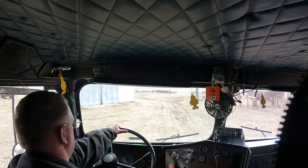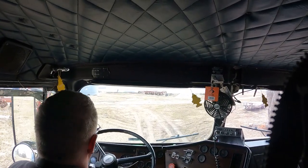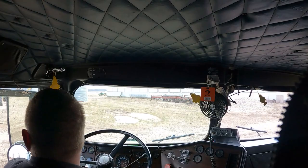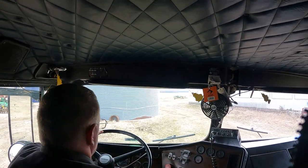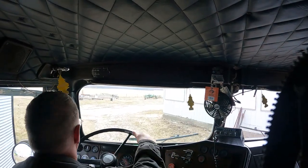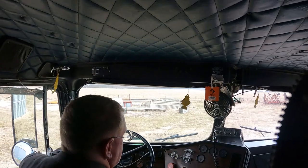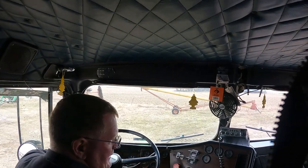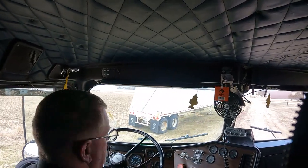Anxious to get Rona out on the road and see how she runs. Had the overhead done, obviously. We ended up doing all three head gaskets. Two of them were leaking. Well, I ain't gonna do two of them, we're that far down. All new head gaskets, serviced it, all new filters. We did put a fuel line to the front of the head. Pittsburgh Power says it's worth 25 horse. I have my doubts about that, but everything was apart. It was easy to do.